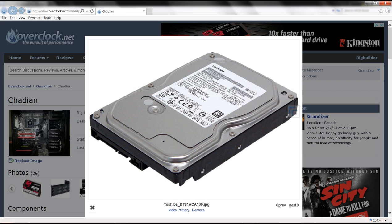One product code is 'CA' and the other is 'BA' - the CA has the faster rotational speed at 7,200 RPM while the other is 5,400 RPM, so watch the product code. These drives are worth the money - I'm getting transfer speeds of 210 megabytes per second drive-to-drive on this rig, which is exceptional for a mechanical drive. I swear by these drives, haven't had any problems, highly recommend them.